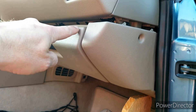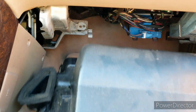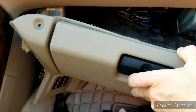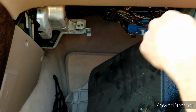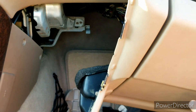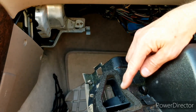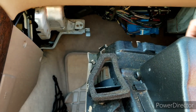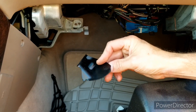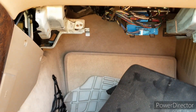There's a big gap between it and the rest of the dash and I'm ready to take it out, which is going to be kind of tough. To remove it — I couldn't film this unfortunately — you're supposed to pull it slightly forward, twist it down with the left side down first, peel back the center console, and then remove it without breaking anything. It tends to hit on the left-hand side and also jams on the ducting and on these two tabs, one of which I've broken when I removed it. The duct going to the vent also holds you up. It's very, very difficult to do. I don't think I would do this again without removing the center console. I've broken a piece of the duct off as well as those tabs — both things are repairable, and I'm going to have to do that before I put it back together.